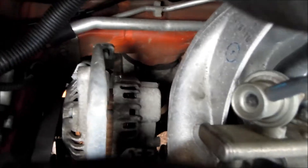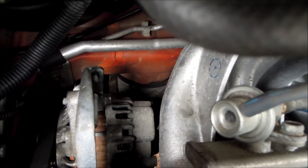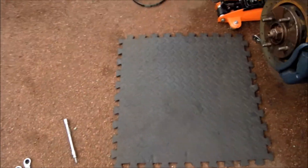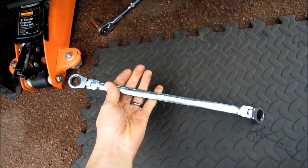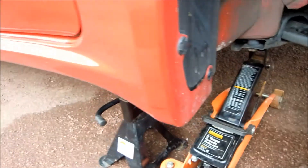The main drive belt system pivots on the alternator. There's a bolt and a bracket, and the alternator moves around on that bracket. What we need to do is release the alternator — we don't have to remove the bolts completely, we just need to back them off. You'll probably want a flexible spanner for this, preferably with a ratchet head.